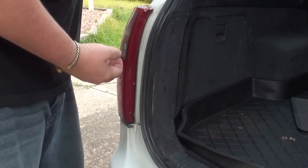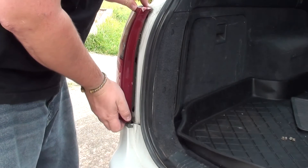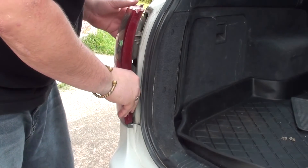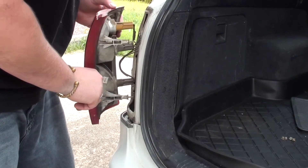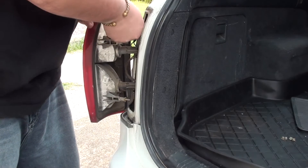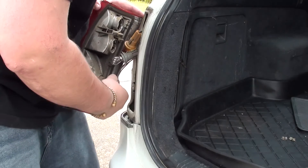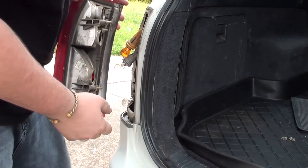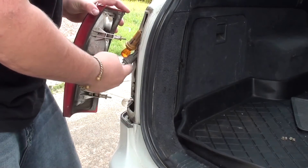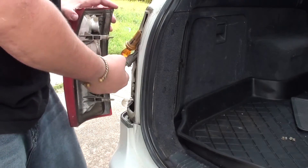Now you've got to be careful when you're pulling the lights out front — just grab it from the top and the bottom and gently try and wiggle it out. You might have to go to the sides a few times just to gently break the seal. Don't pull it up too hard. Once you've got it to about here, you'll see where the three light globes are connected — you just need to do a simple half turn to get them out. Sometimes they get a bit stuck. I find it's easier to undo the four screws, pull it back, and then gently undo them.